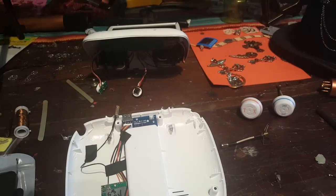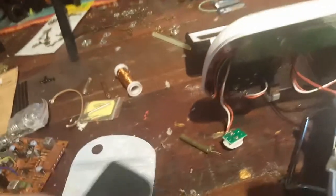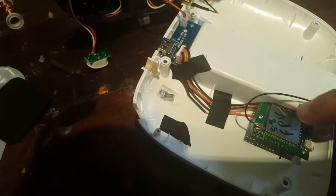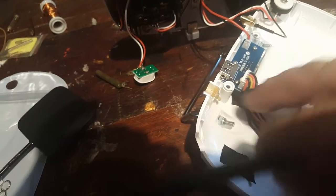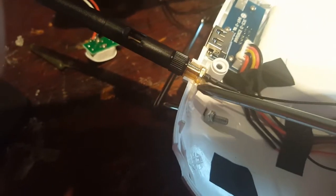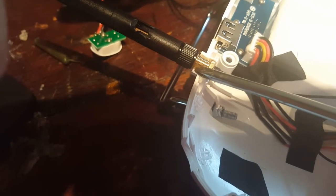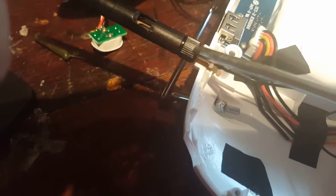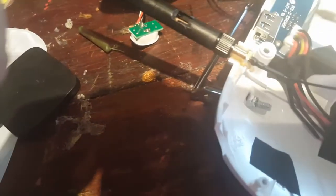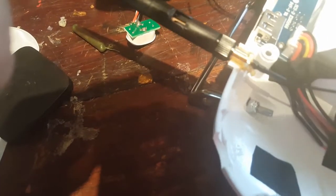Once you've bought your diversity antenna kit on eBay, Amazon, Banggood, or wherever — plug it in and connect it down here, then drop in a bit of hot glue. To set the gap, hold it in and screw your antenna on all the way down so it's nice and tight. With the UPair One there's a little cutaway here — it sits in with about two to three millimeters clearance from the outer casing to the bottom of the antenna. I've checked both and they're around the same, so you've got one to two millimeters clearance. Keep your antenna on and lay it back into the hot glue.